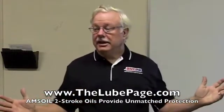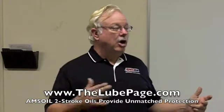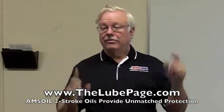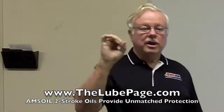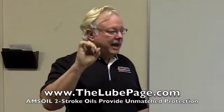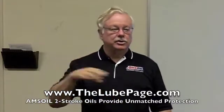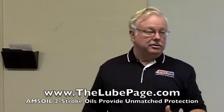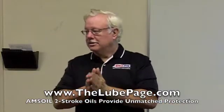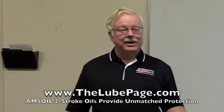You know, the engines that he gets in that are running standard petroleum two-strokes, first thing he has to do is decarbon them. And by the way, power foam is one of the best decarboning agents there is, because they will be so choked up that the exhaust ports coming out of those engines are half the size they're supposed to be. So in a two-stroke engine, when you can't get the exhaust to go out, you don't suck in as much new air. So you can imagine if 10% of the old exhaust doesn't get out, I only brought in 90% new air, I have 90% power.